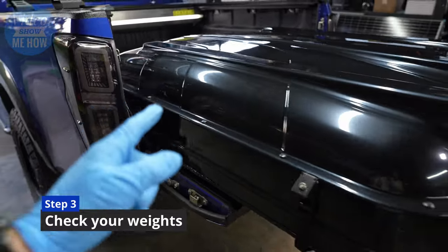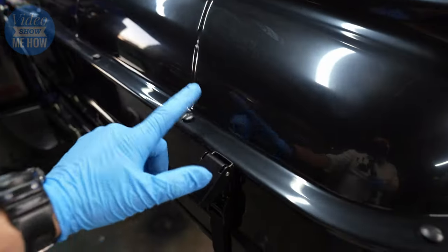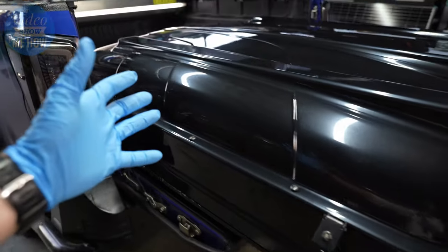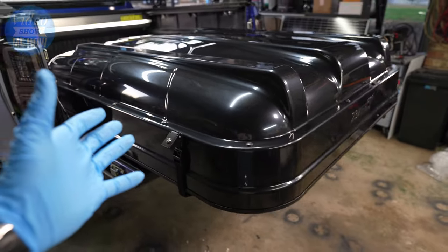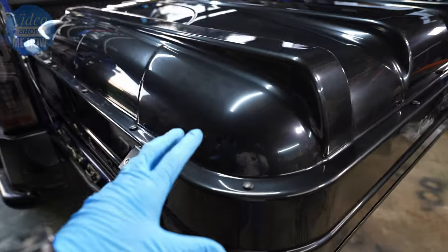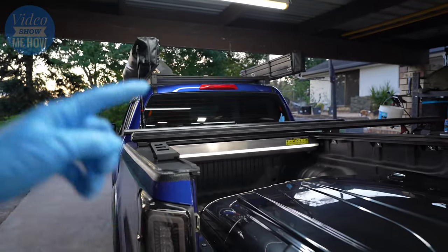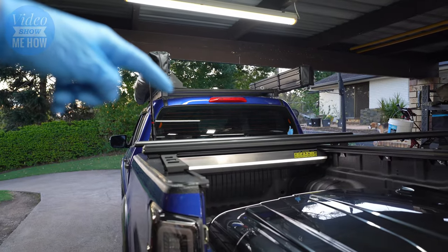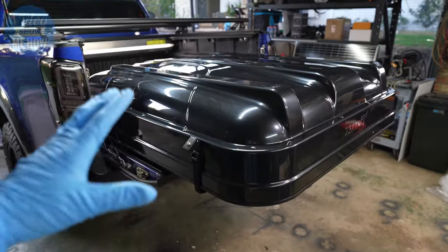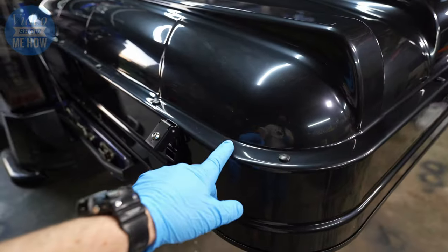From here I recommend getting this guy installed onto its final resting place, and that brings us to an important point. When installing your rooftop tent it's really important to consider the weight rating of what you're mounting it onto. This guy comes in at 79 kilograms. If you're putting it on your car roof you want to make sure it's rated to carry that. In our case the D-Max is good for 100 kilograms, but you need to subtract anything else already up there — our rack is 22 kilos, for example — so make sure your net load carrying capacity is enough.